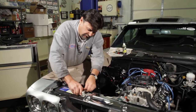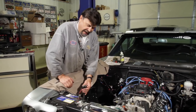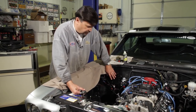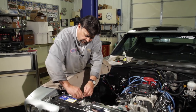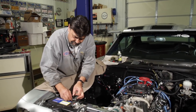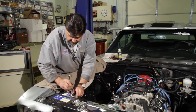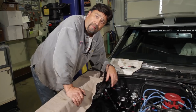The radiator is topped off with the coolant we drained earlier when replacing the temp sensor. Before hooking the battery back up, here's a precautionary warning: connecting the battery cable can cause a voltage spike that potentially damages the ECU. So disconnect the power source to the ECU first, hook up the battery, let it sit a minute to let the electrical system stabilize, then initialize everything with the handheld programmer. Once that's done, turn the key to energize the whole system and check for any fuel leaks. Now we power up the ECU.